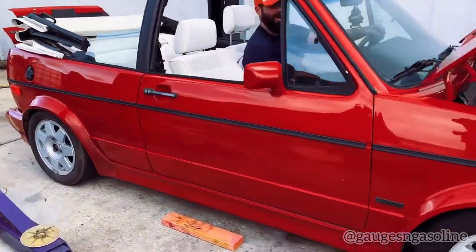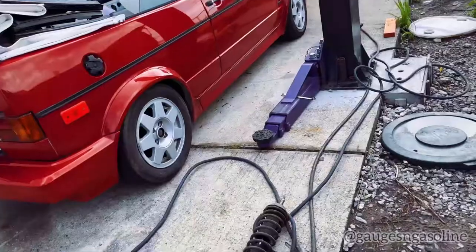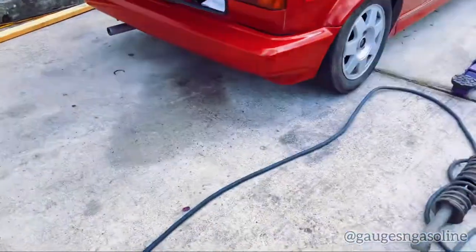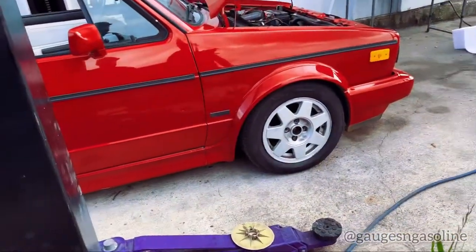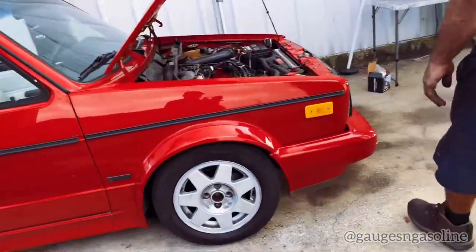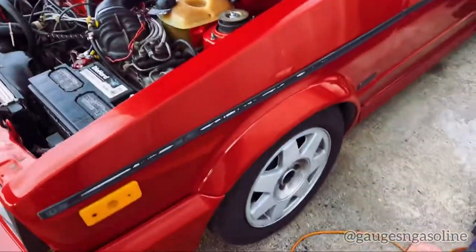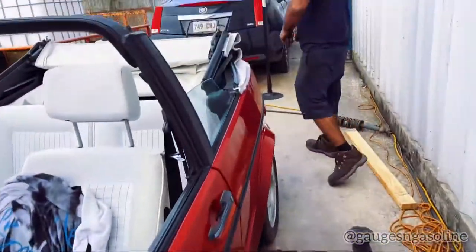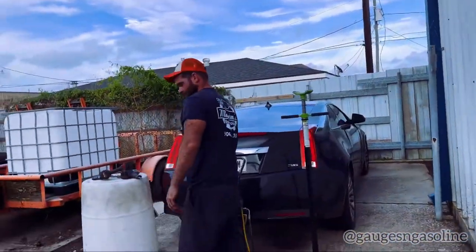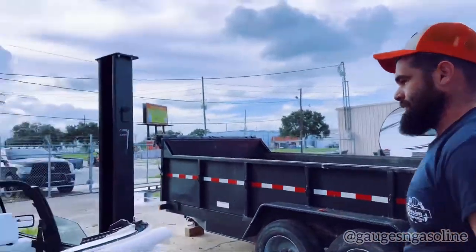Alright. Back is real low. It is, huh? Oh god, yeah. I think the front looks good. Like, I think the front looks perfect. Let's see what the tape measure says. 21 7/8 inches in the rear. So we gotta go at least another inch up. Right? In the rear? Yeah. Yeah, I would say an inch.